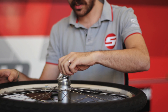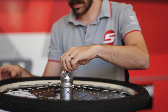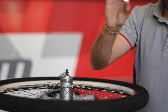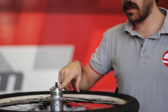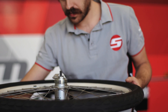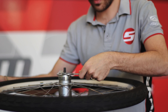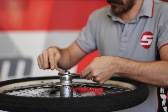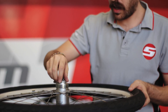I need to take my axle nut off of the coaster side, then my no-turn washer, then I have access to two 22mm nuts that hold the hub so that you get no play. I'm going to take a 22mm wrench, slide it on the lower nut, then another 22mm and break this fit. Once I have that off, it's very easy to remove these two nuts by hand.